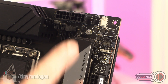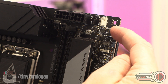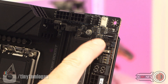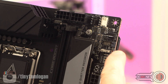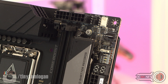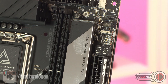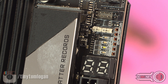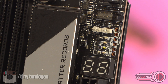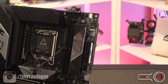It can't add that much extra cost. There's a CPU fan header and then a double header marked as pump and Sys1, plus another system fan header. Then there's the proprietary header I mentioned for the fan-out cable, which handles the front panel, ARGB and PWM — it all wraps around the back. You can see some voltage monitoring points for a multimeter, and then the LED readout with the four normal indicators: CPU, DRAM, VGA, and boot. Underneath that you've got your full POST code readout for diagnosing any posting issues.